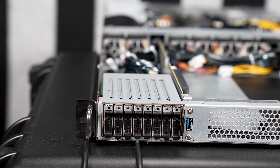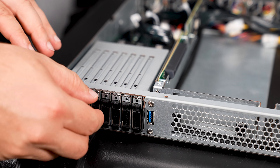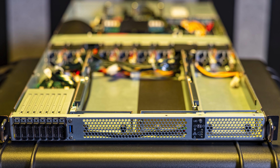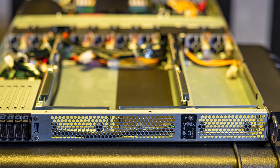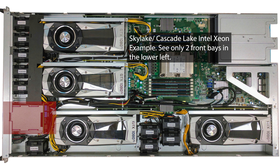On the front of the system, we get a total of eight NVMe SSDs with PCIe Gen 4 x4 links, which is something very different. Normally in a 1U 4GPU system, you're really lucky if maybe you get two 2.5-inch hot-swap bays. The 2.5-inch SSD is so big, and you just don't have that much room because you need the majority of the room in the server to move air through and cool GPUs and other components. A major challenge in all of these 1U systems is always being able to get enough local storage, because otherwise you have to access remote storage with higher latency. You want at least some cache locally, but the 1U form factor typically can't accommodate enough SSDs — and that is exactly where EDSFF comes in.